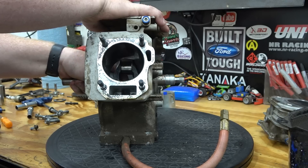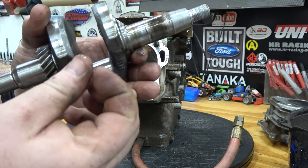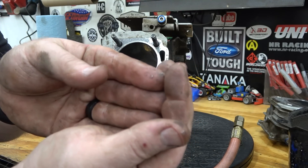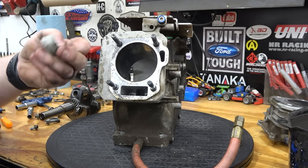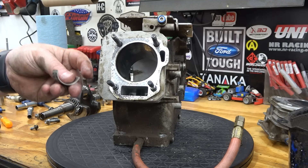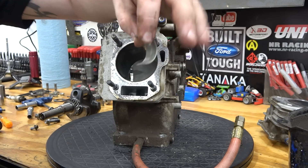Let's pull the crankshaft out because I saw chunks on it. There are the pieces we were missing. The crank looks great — long as it checks in spec for oil clearance it's going to be perfect. There's one of our chunks on my fingertip. Our biggest flaw was the cylinder walls don't look great — not scarred up or anything, but you can tell where dirt has done its job. It feels pretty gritty in there. A good hone job — I've been wanting to buy a ball hone forever. The rod bearings were getting pretty desperate on this one. This would have broke real soon — probably halfway worn through on those cracks. Pretty cool that we checked that out.